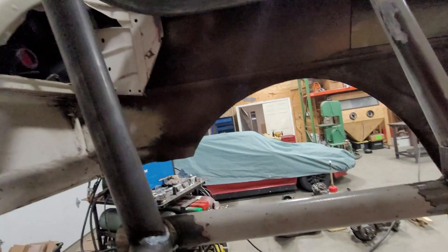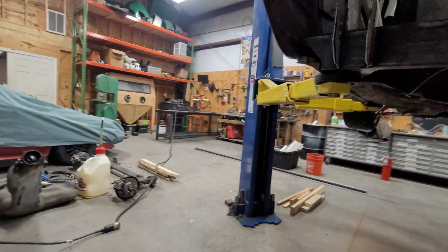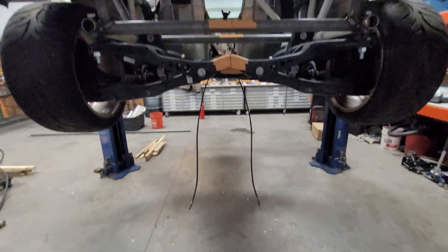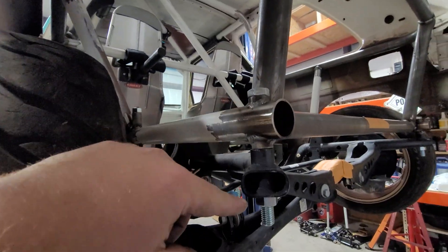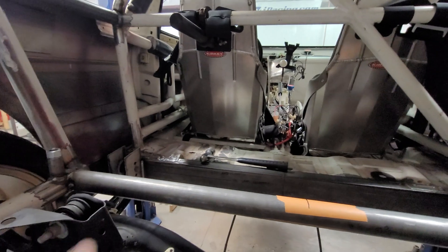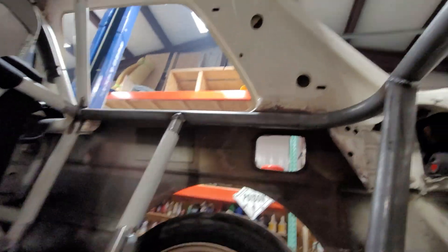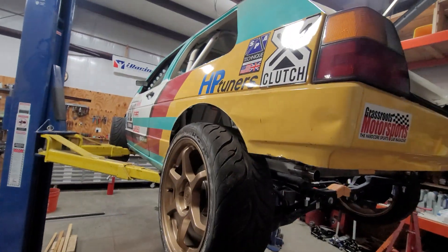Give you a quick tour. Before this video ends, I'm going to go ahead and throw the subframe back underneath it, so I'll show you guys what that looks like now. Before I drop it, I just want to quickly share — just 5/8 bolts, three-bolt those four locations right there. You can see up front those tabs are left a little long. I'm going to trim those up and I've got more tubage and all that fun stuff to add. They're rough cut in right now. Let's get this thing on the ground and share what it looks like.